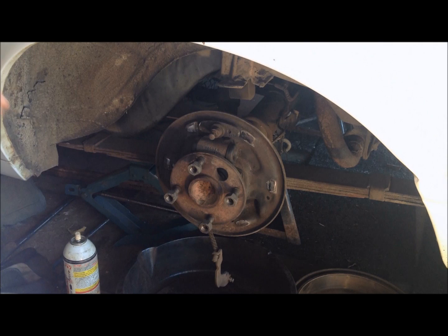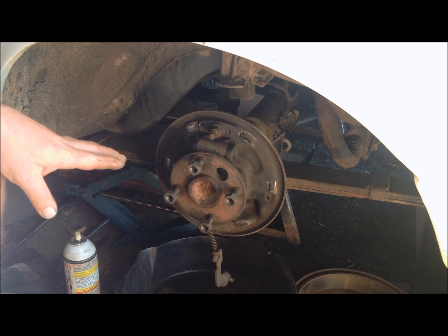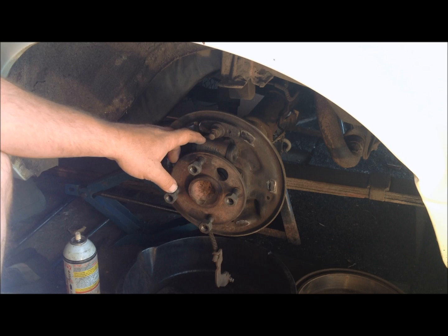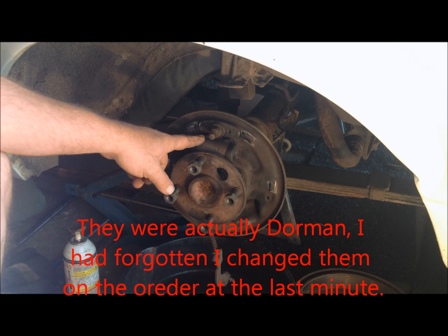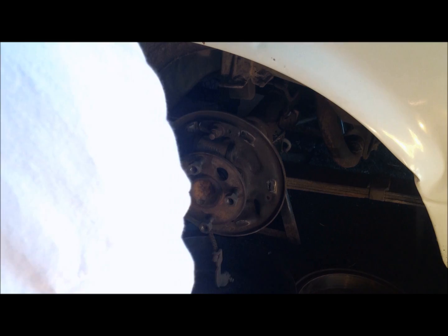Now we've got these pads buffed and smoothed down. We're going to put a new wheel cylinder on. These wheel cylinders weren't leaking, but we don't know exactly how old they are and I don't want to risk doing all this work and having to redo it. They do make rebuild kits — you can hone them out and put new cups and end rubbers in, which isn't a bad idea if they aren't pitted. But we just bought new Wagner brand ones for about $6 a piece.